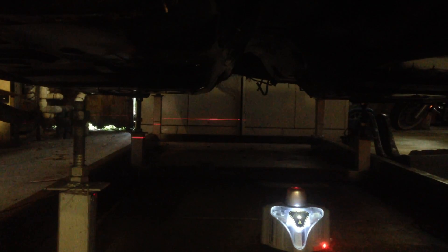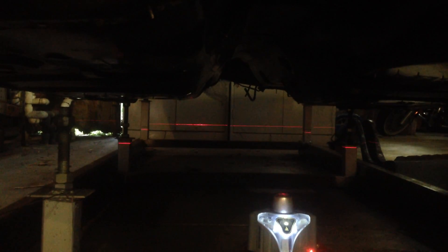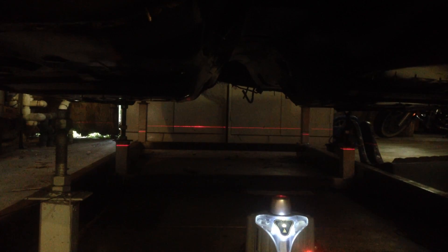We've got a little update here. As you can see, we've got a little laser level laid up on the frame jig here. You should be able to see where it's striking a line. This isn't the exact line because I just stabbed it back down here for the video, but we've already marked the lines where everything's level down here, so that we have a good place to get body measurements off of.